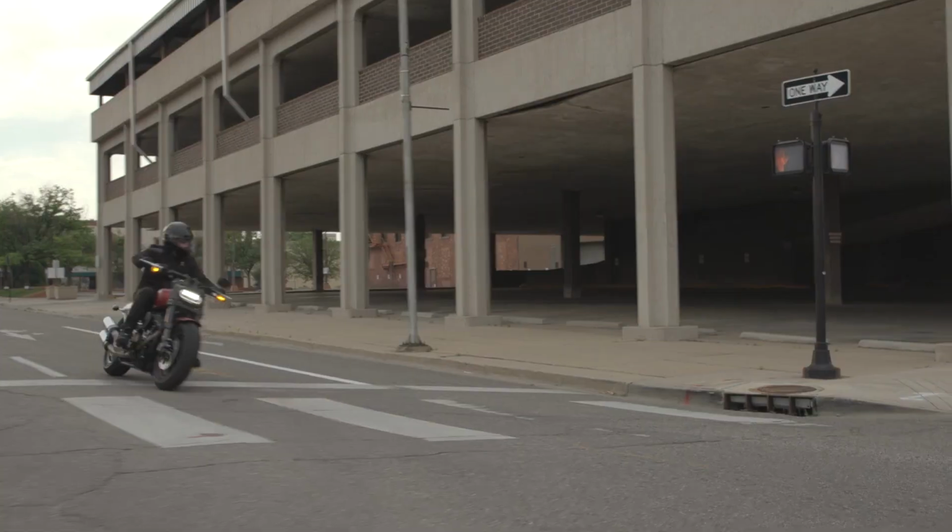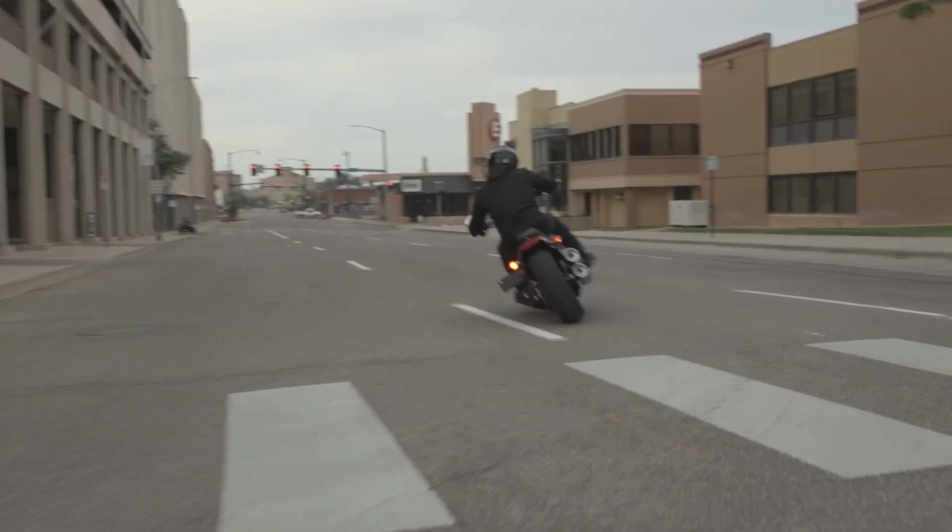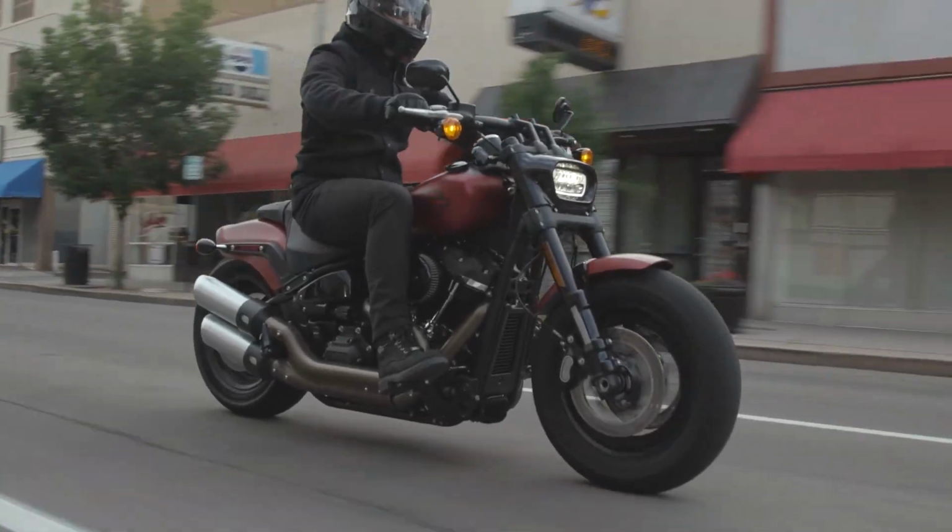With Harley-Davidson, all tires, and air shocks for that matter, have the expected possibility of losing up to 1 psi, 1 pound of air per day when used or not in use. Therefore, if you go out and check your tire pressures after the bike has been sitting for a week, 7 days, and you find that it is several pounds down from what it was before, that is not necessarily a sign of problems. It may be entirely normal within the specs of the tire.